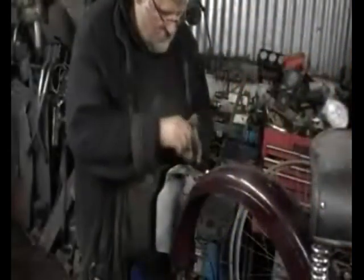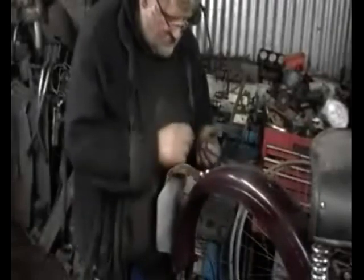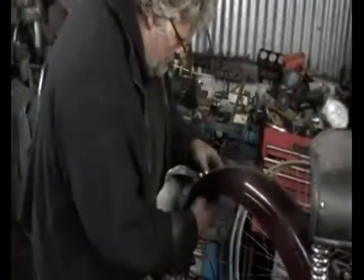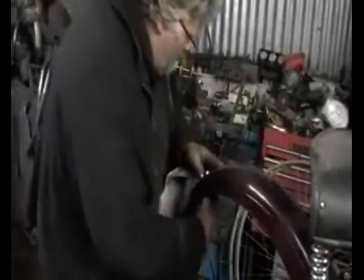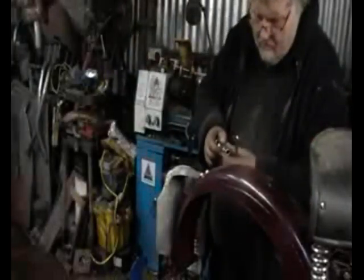When you actually go in and look at it you realise just how basic these bikes were. It had a bulb horn so there's no wiring to a horn, there's no brake light, there's no kill switch — you're just supposed to stall it, have the carb set so low that when you close the throttle she cuts out. There are four main wires which then branch into a dip and a main beam at the headlight, and a spur is taken off the tail light feed to light up the speedometer. Can't get more basic than that.